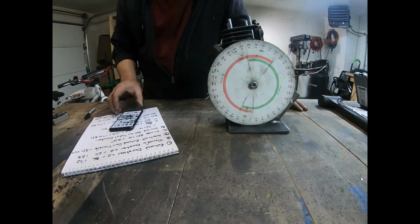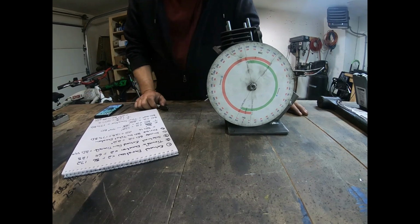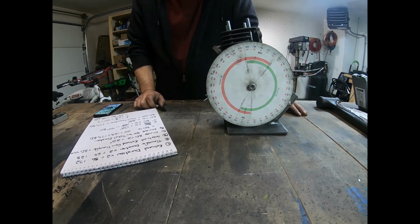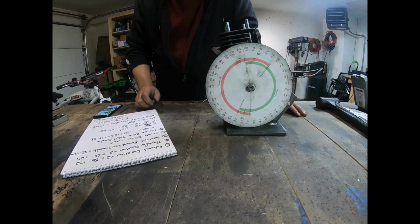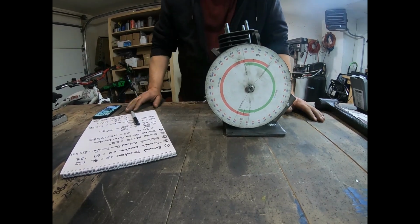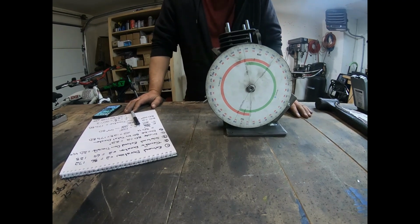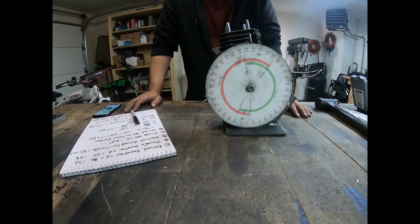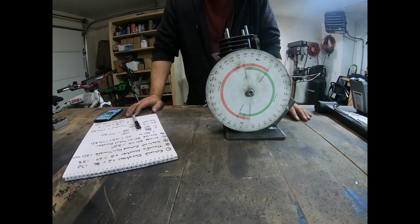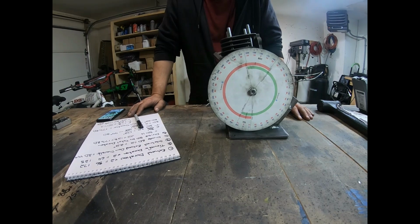Okay, so I'm going to go ahead and do that. You can keep it at 17%, and it'll be hitting a little bit lower, or take it up to 19%. It all depends on where you're at. This is where this cylinder is at. A lot of the other cylinders, they have different port timings. You can decide where you're going to take yours. This one here is going to be in around 17% blowdown to 19% blowdown.